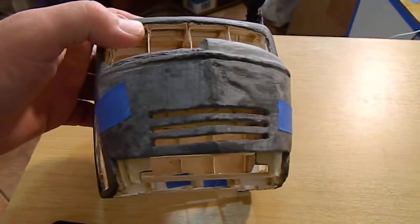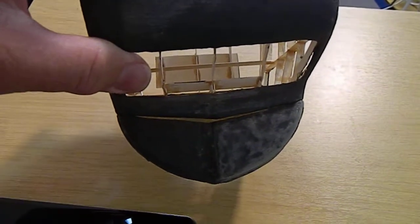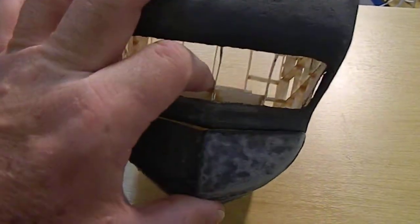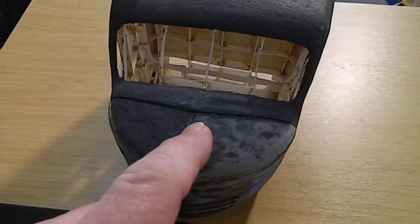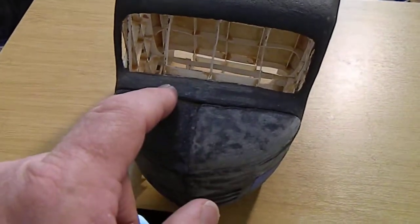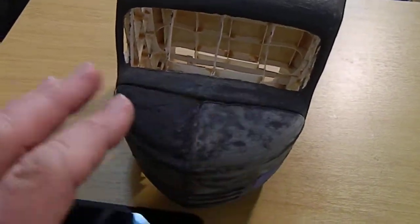On the passenger side, I actually had to fill in some space to make it flush with the frame. What I did is I took a piece of paper, cut it out to make a straight edge, and matched it up where it would line up with the frame of the cab. Then I put the paper across so I knew how far out to bring the epoxy to fill that in where it wasn't matching.